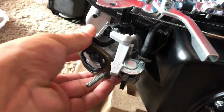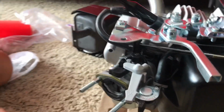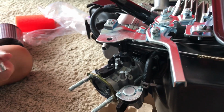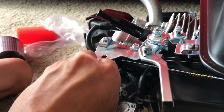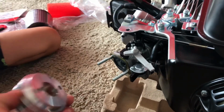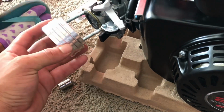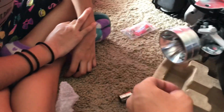There's a throttle body. So let's get this one, and I think we're gonna have to undo one of these. Okay, yeah, undo this one and probably this one. All right guys, so here's a V-stack here. So this goes straight here. There was this little piece, but we're not undoing a lot of stuff, so it's just basic bolt-ons. I'm gonna keep the governor on for now to figure out how much power it's gonna have, but that's the way it goes.